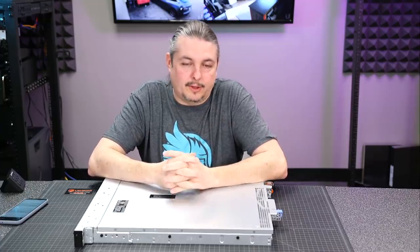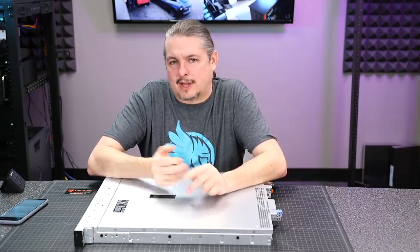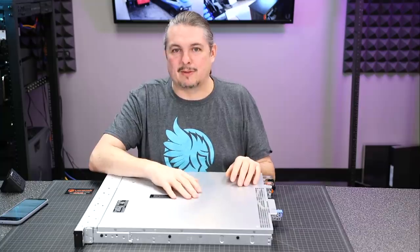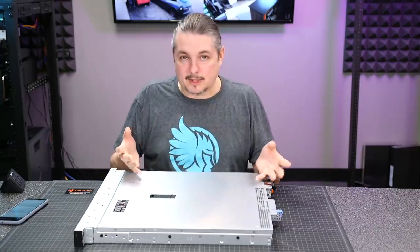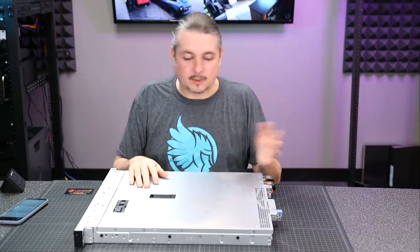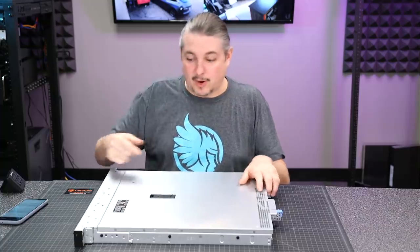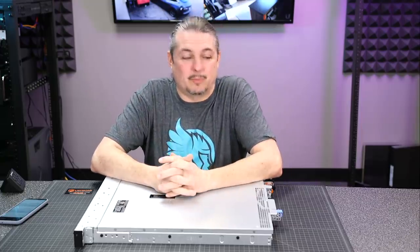That's it for the Dell 340. We're going to get this project rolling for the client - it's got to get delivered. When I set these up, we match it to their environment. I'll grab a laptop, set it on top here, match the IP ranges to their environment, and set the IP address as static. So when we drop this off and their IT team racks it, they already tell me what IPs they want it set at, and we already have the password set to what they asked. Everything is set as soon as this boots in their office. We've already done a little burn-in testing - we load it, put some VMs on there, spin them up, stress test them, delete them, and reinstall the OS one more time to make sure it's nice and wiped clean. No issues, no crashes - it'll get rack stacked and ready to go, and we'll finish the P2V project.